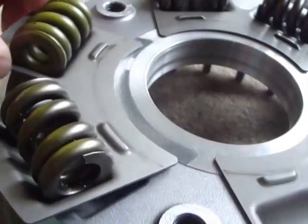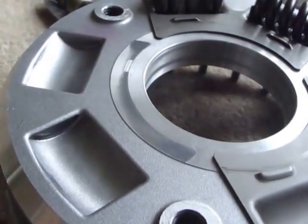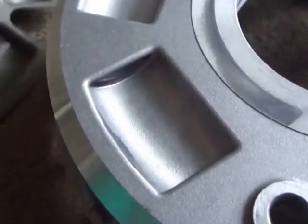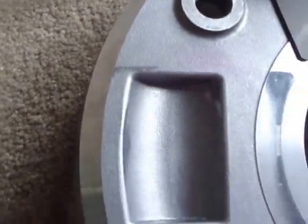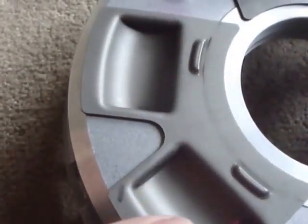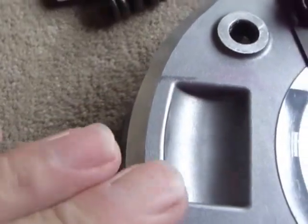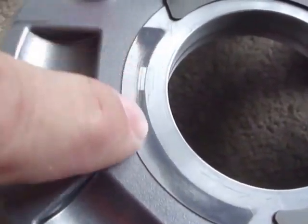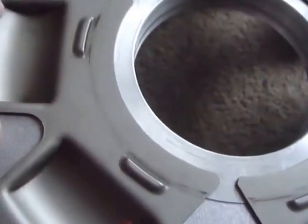I'll demonstrate further what's been going off. You can see where the heel of these three segments rubs on the hub centre there, and also you can see where the polishing is taking place where the back of the segments has been sliding up the ramps. Also there is a little mark here — I showed earlier how the piece lifted up and then the front went down when the next phase came in. This mark is where the leading edge of the plate has gone back down and started to dig in. We can see the shape where just these corners have actually made a mark in the hub. That's because the whole item has been lifted up and these corners alone have been touching the alloy while everything else was clear.